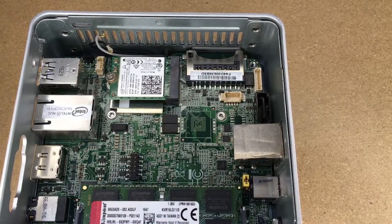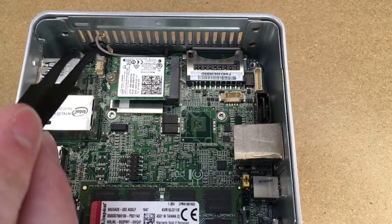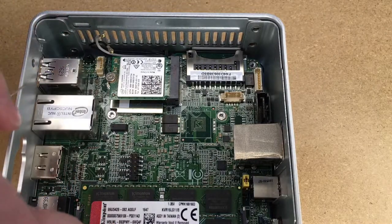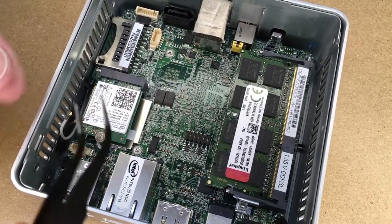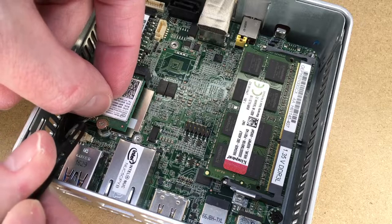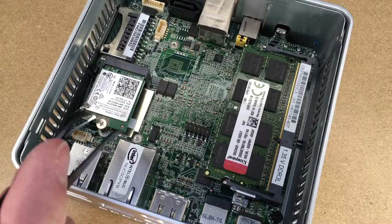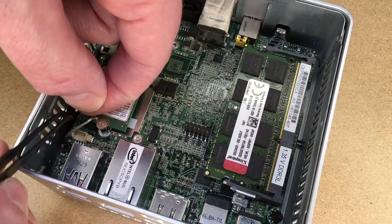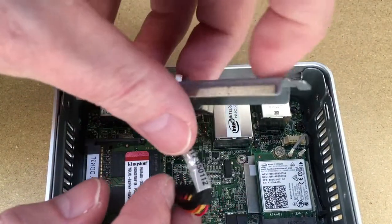I've installed the motherboard screws. The Wi-Fi antenna cables are a little tricky — there are two: the main, which is gray, and the aux, which is black. I'll use tweezers to get them in position and then press them down with my finger. I have a pretty big finger so this is a pain, but make sure they're lined up properly and don't force anything. I've had these ends come off before and that's not good, so don't pull on them. Next I'll put the VGA port back in — plug it in and put the screws in.